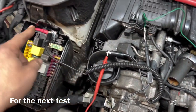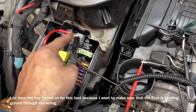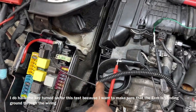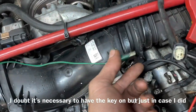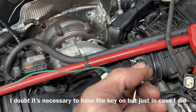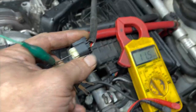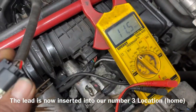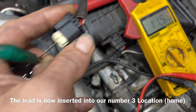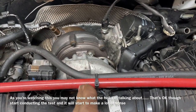We want to make sure we're not on something conductive so it doesn't short out. Now taking our positive lead and hooking it up to a constant 12-volt source, and taking our ground lead and hooking it up, we're going to check for ground and make sure we don't have a bad ground system sending ground to our sensor. With the probe pushed in there we should have battery voltage, which is why we don't have 4.9 volts — we only have 11.5.